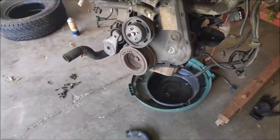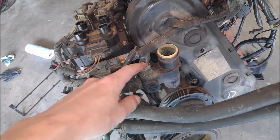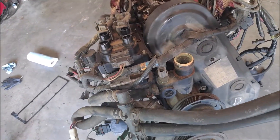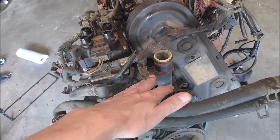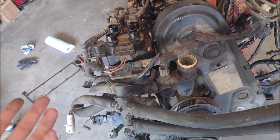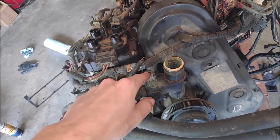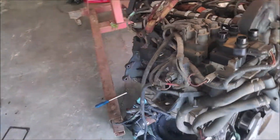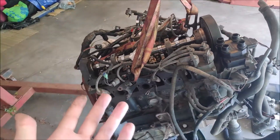The next thing is really up to you — the thermostat housing. The 2.5 liter runs a plastic thermostat housing and has an extra sensor. Unlike the 4.0 liter, the thermostat housing doesn't have a tendency to crack, get damaged, or leak. I've decided to keep the 2.5 liter original thermostat housing, but you can swap for a metal 2.3 liter thermostat housing. The main differences are the 2.3 is metal and won't have this extra sensor. Once you have all those things done, your 2.5 liter is ready to be bolted into your 95 to 97 Ranger or B2300.